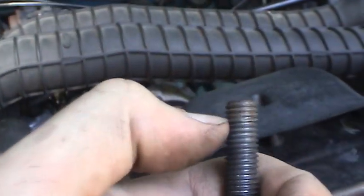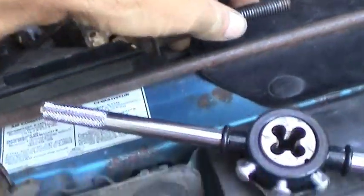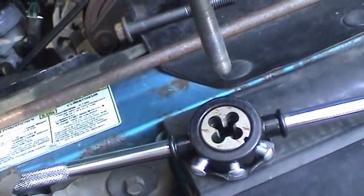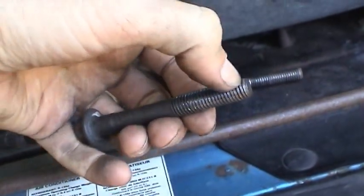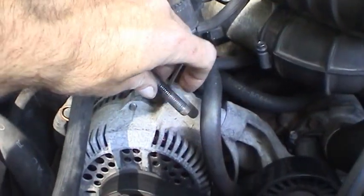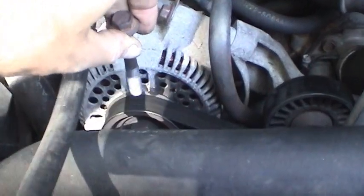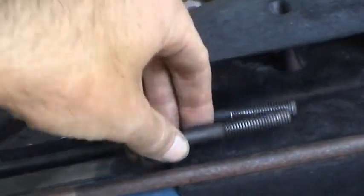There was actually a piece of aluminum material from the threads left in here. If that happens to you, you could just take a tap and die set, put a die in here, run it through the threads, and clean up those threads real good. Before I go back in, I'm going to put some anti-seize on these, because these are dissimilar materials — steel going into aluminum — which tends to set up a corrosion process. That way, if I have to take that alternator out in the future to replace the front and rear bearings, it won't be quite as difficult to get these bolts out again.